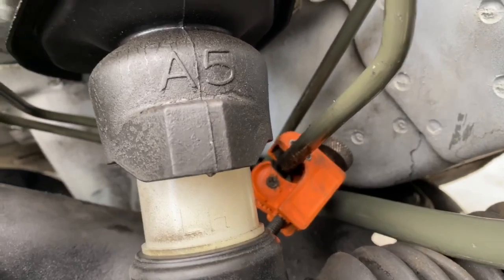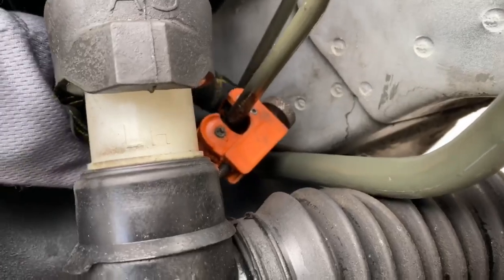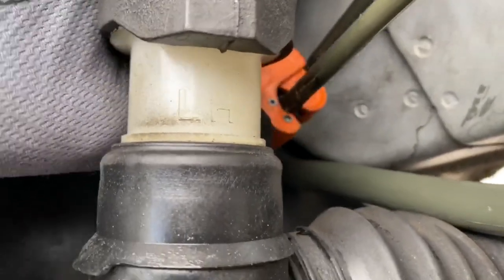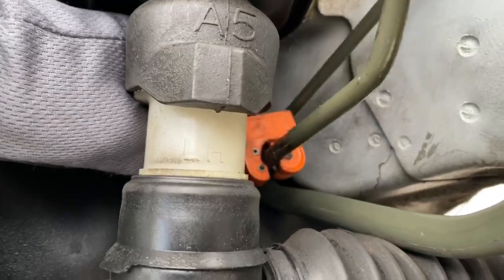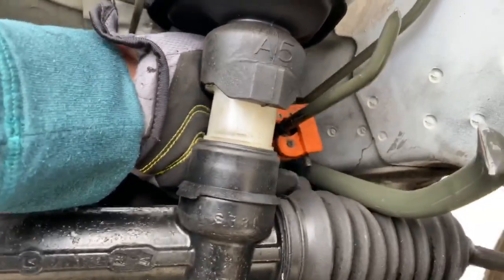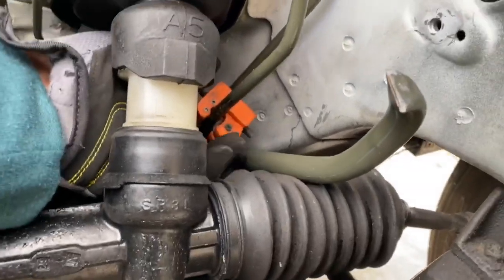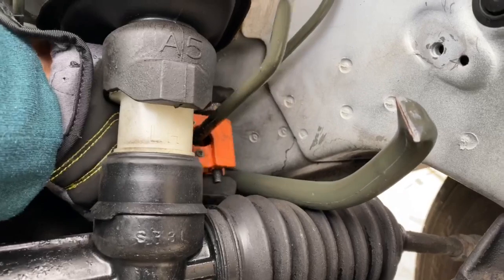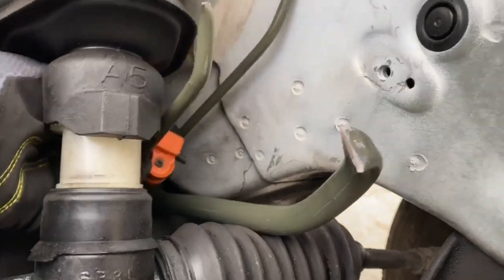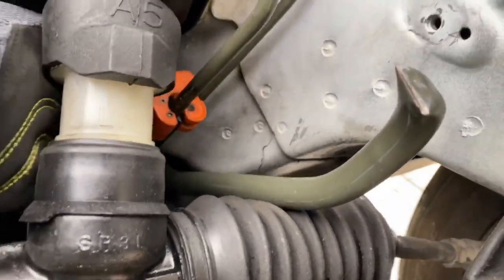Real quick, I'll show you guys how the tube cutter works. All you have to do is leave the tube cutter on there, tighten it real tight at the top, and the little wheel acts as the cutter — so all you have to do is keep rotating. One thing I wish I would have done: it's been a while since I built the car and I'm a little rusty — I wish I would have done the lines before I put my rack and pinion in, which just would have been a little bit smoother. For now I just bent this vent tube out of the way and I'm gonna remove it, and I'll be showing you guys what I'll be doing with that.